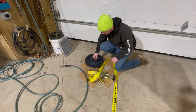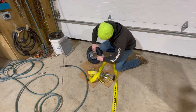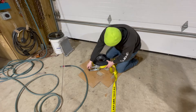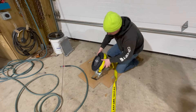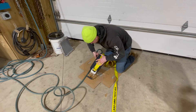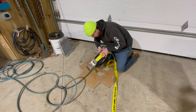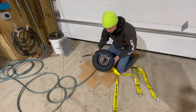Here's a quick trick on these little tires. Any four-wheeler style tubeless tire — setting the bead can be kind of difficult. What I've learned is if you just use a large ratchet strap like this, it tends to go pretty quickly. I prefer this method, especially when working with freshly painted wheels. Get that nice and tight and it'll seal up, then hit it with a little air, back the strap off, and just like that — pretty simple, that's all there is to it.